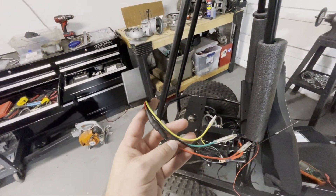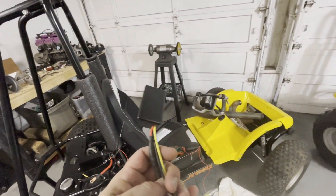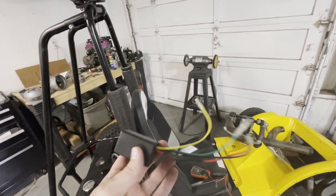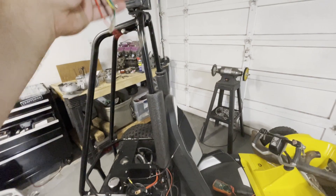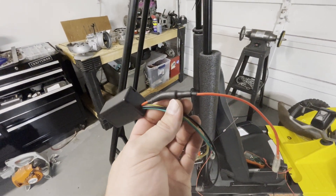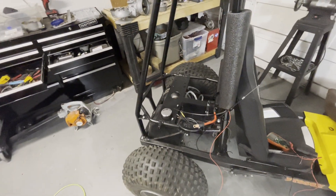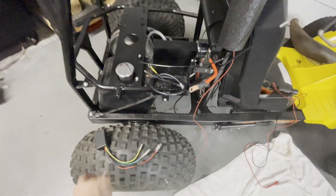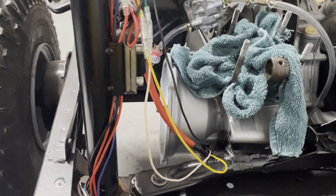I made this up and have no clue if it's going to work long term, but I did test it on my other Odyssey. Inside here I have a 6 to 32 volt AC input, 12 volt DC output, full bridge rectifier so that I can power my 12 volt lights off the 6 volt charging system. I'll put a diode in here so that hopefully this can charge the battery for the electric start, but I will be fusing it just in case that creates a problem. It's going to look like a bit of a rat's nest but I'll clean everything up once everything's tested and I know it's working correctly.